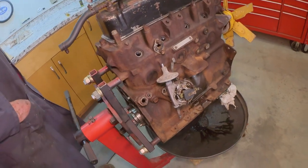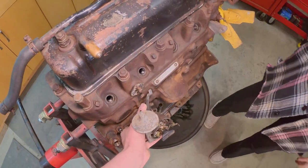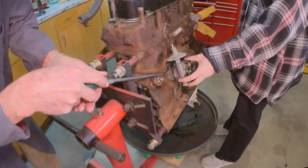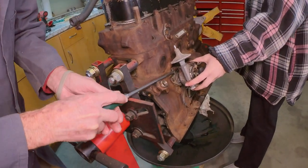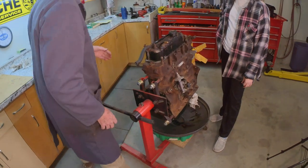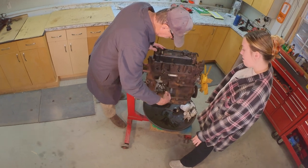No, you're going to need that little ratchet one again. Ratchet? This thing? Yeah, just like you did on the first. We've got to get that out of there. Well, let's see what we can use. What's this thing? That was the clip that held the distributor cap on. Gotcha. So that's got a tensioning device. Are you supposed to see how it's pinched? No, I don't think so. Oh, you just pinch it on the distributor after you get close. Right. You have to get your timing close, and then let's see if we can try rotating it. And maybe let's break that loose. Where's that wrench you just had? The little one that you just had in your hand. Oh, that's it. 7/16. I think so. Yeah, that's it. Let's see if we can back this off and take the distributor out.